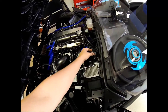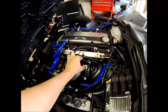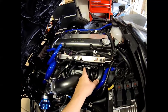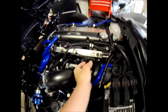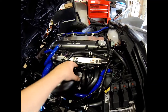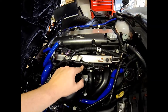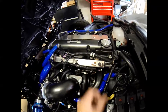When you're done, plug them back in and clip them — when your ECU has been reprogrammed, you're good to go. Here's where the map sensor sits. When you go from a one-bar map sensor, this plug right here goes directly into the one-bar map sensor. You'll have a two-bar map sensor, which is right here — you can see I zip-tied it, but it just plugs into the old plug. You press these two things together with the pliers and then take a screwdriver and pry it off.